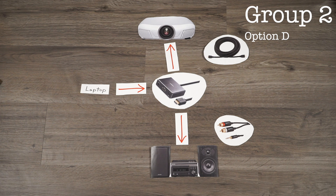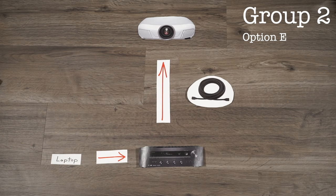Not a fan of those first two options? How about this one? It uses what's called an HDMI audio stripper to send the audio up to your speakers through a 3.5 to RCA and the video back to your projector through a standard HDMI. Still not enough? Then you're going to have to invest in a full blown AV receiver. You connect your source to the AV receiver via HDMI, it will then strip off the audio and send it to your speakers while sending a video pass through via a second HDMI cable back to the projector at the back of your room. This is by far the priciest option but it's really the correct way to set up a home theatre, and any quality home theatre will be set up in this way.